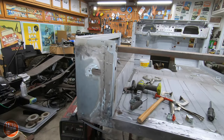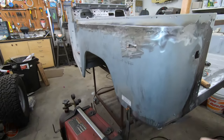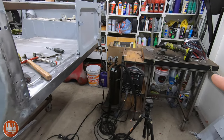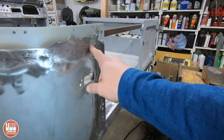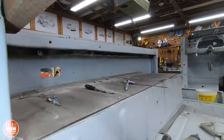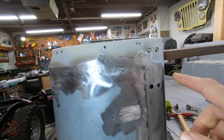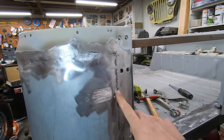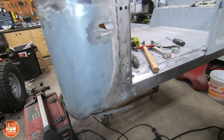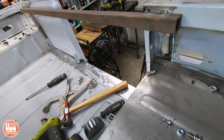But I am making good progress. I've got the quarter panel on, and you can see I've got both welders here — my MIG welder and my TIG welder. I use the TIG welder along this whole seam because I can't access the back side of that weld to clean it and protect it, and I wanted the cleanest weld possible. But in other areas, like this section here, I just used the MIG welder, which is much faster. I'm going to be pulling this upper panel out so I'll be able to clean up the back side of that weld.